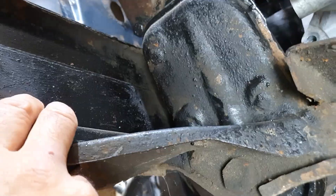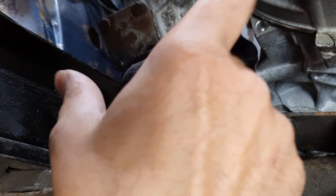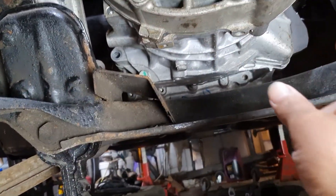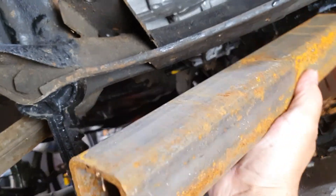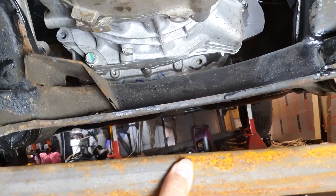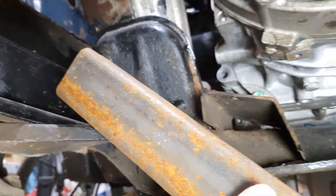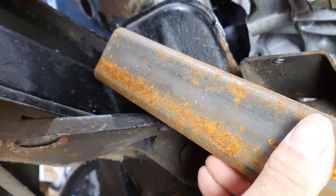My only option is these chassis rails. I was thinking of making some mounts that come off at an angle, but I don't know if the structural integrity will be good enough coming off just at the side - that's why I'm thinking of building a cradle, because it acts as a stabilizer across the front of the motor. I just found this off-cut piece of two-inch box section - I'm sure it's more than ample. If you can visualize the picture: try not to come any lower than the subframe - that would be the piece across the bottom coming down at an angle off a plate.